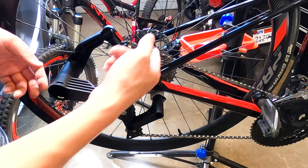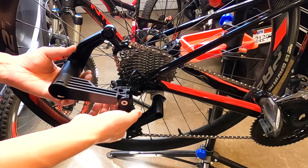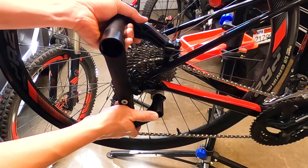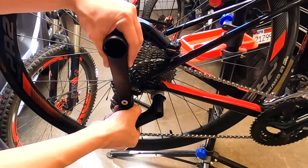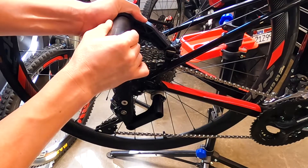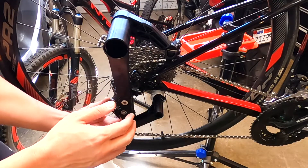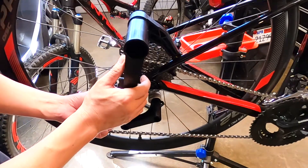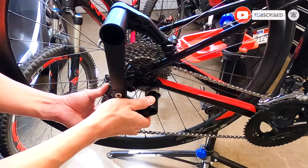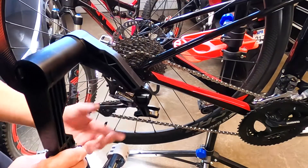Now with the wheel back on and the chain hanging here, let's try to return it to its proper position. Pull it up. It's very easy — because there's tension, it's easy to turn. Now this one should be able to rotate. Here's where I think I would hold the derailleur back a little to help with the process. Pull this out of here. That's it. Boom. Good to go.